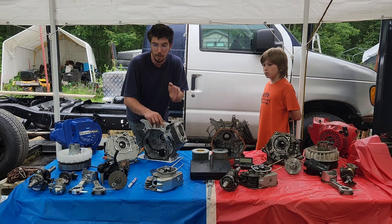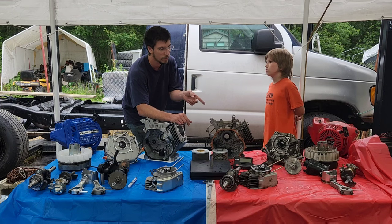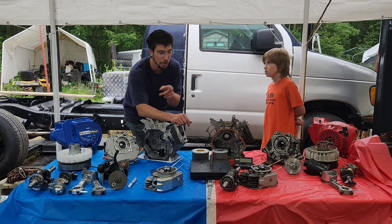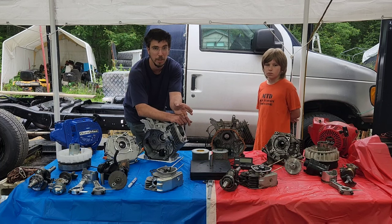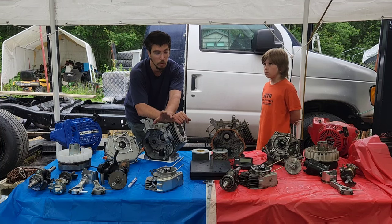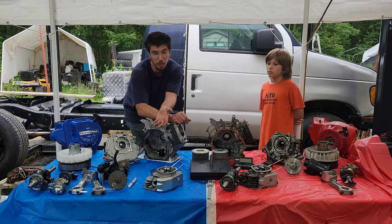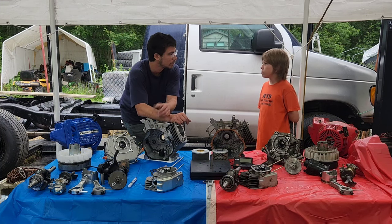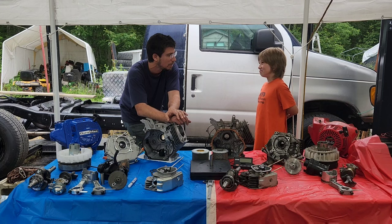The full cheater stock best build on the table would be: Duramax block, Duramax side cover, Duramax piston and rod, GX wrist pin, GX crank for long-term trust, Duramax head for better flow without question, and Duramax cam because it's lighter and therefore faster. Duramax flywheel too. Send it to the moon — that's what you do. Send everything to the moon, and don't care about that RPM sensor. This is why we have throttle limiters on everything you drive.